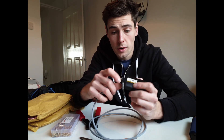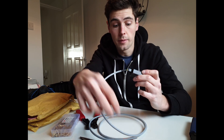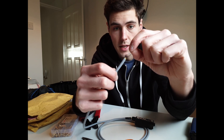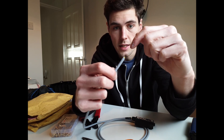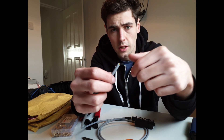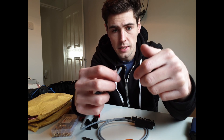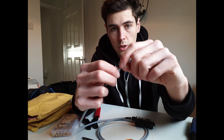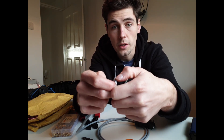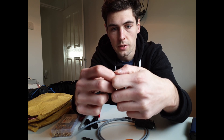With the EDL-1 you actually get a pre-terminated cable, and inside the PVC on this cable is an earthing shield that protects the cables inside from electromagnetic interference. That's quite important, especially when you're using this for logging at high speeds — you need to make sure the readings are precise. We're going to be terminating that to a chassis ground, and then there are four wires inside but we're only going to be using three: a five volt power source, a signal ground, and the serial transmit cable.